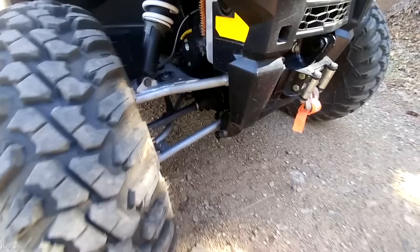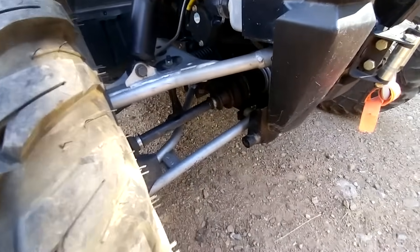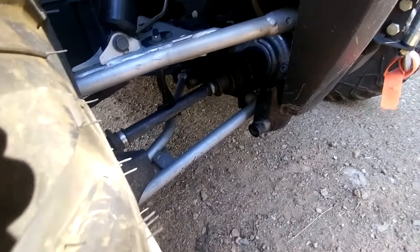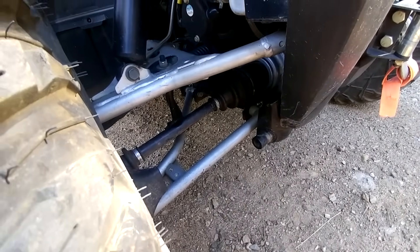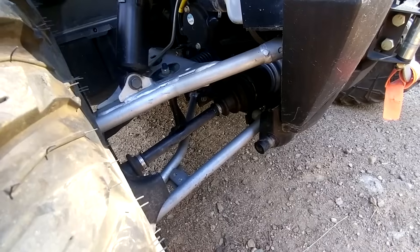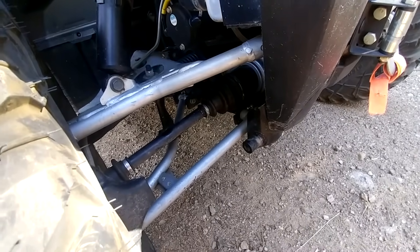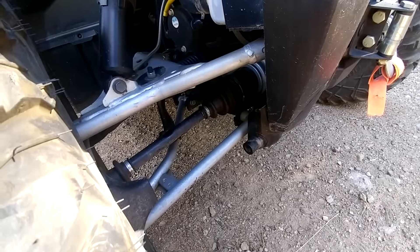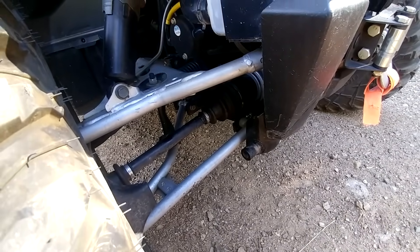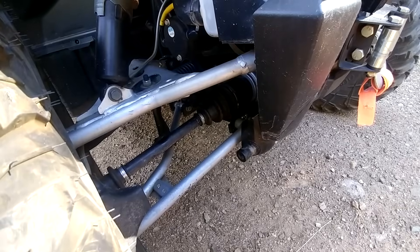Not the least is the driveline sloppiness. I just had the front diff rebuilt — more out of being out of spec than any exact issue. The heavier tires exacerbated the driveline slop in the diff and it made a pretty loud crunching sound. I sent it to RCR in Phoenix for a rebuild; they adjusted the lash a bit and made it quieter. Taking it apart, it was actually in okay condition with no sign of significant wear. The sprag carrier on this machine was metal — a lot of research said it's plastic junk, but mine was metal.